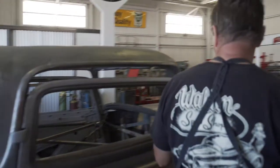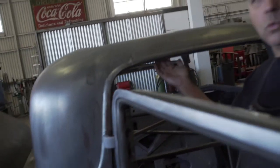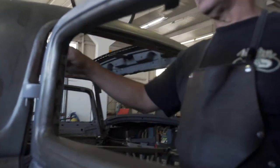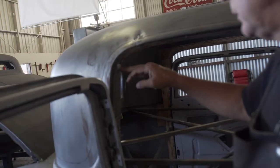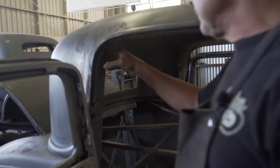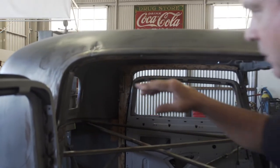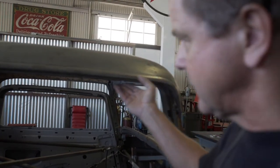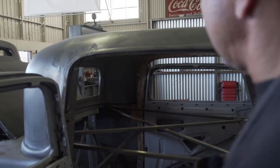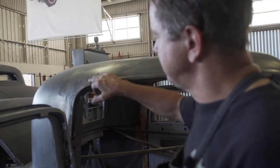And then we're also gonna remove this upper wood in the body. I'm just going to cut the wood because we're going to re-miter it and re-dowel it when we shorten the main post. There's a factory seam, and I'm just going to cut right through it with the Sawzall. Then I got a couple screws just holding it in temporary, so then we'll take all that out. And that'll allow us to get to these factory places here so we can fix them.